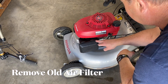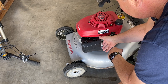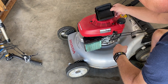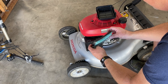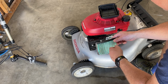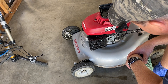The first thing I want to do is take off this air filter. It looks like there's been an impact here — this little clip is broken, but this one is holding on. We'll want to fix that when we put it back together. We've got some grass and a pretty dirty air filter, and no foam element in there. I don't know whether that wasn't in there or whether it got taken out at some point. It looks pretty dirty in here just in general, which isn't that good. Let's clean that up.